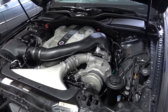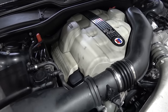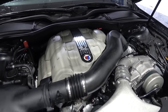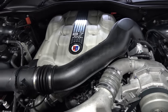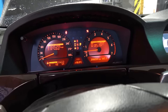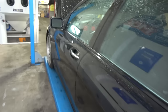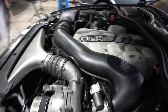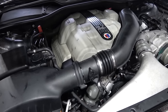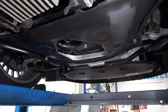We're back in the dojo - we covered 147 kilometers and the engine survived, which is lovely. As far as how it sounds, I think it sounds great. I don't hear any knocks or obnoxious noise, just sounds like a good working engine. 147 kilometers - perfect coolant temperature, no check engine light, no smoke from the exhaust. All is well in Alpina world. I'm very pleased thus far - I think the engine is going to sound even smoother once we have full synthetic in it, but for this breaking-in period we're keeping mineral oil.